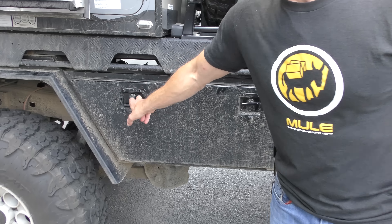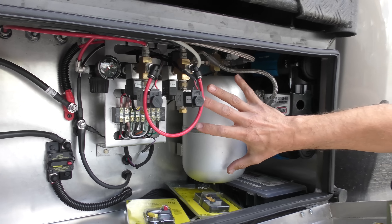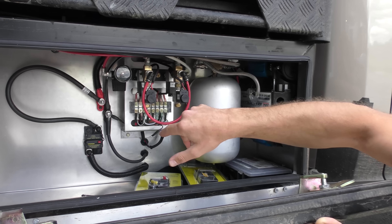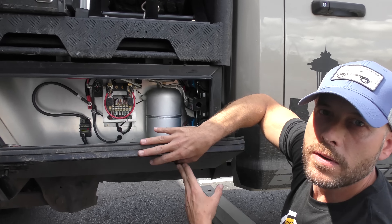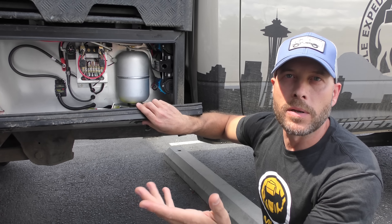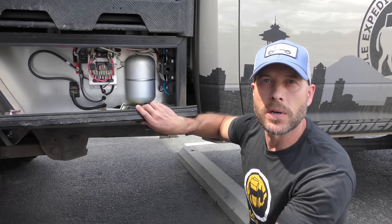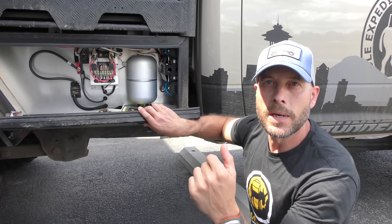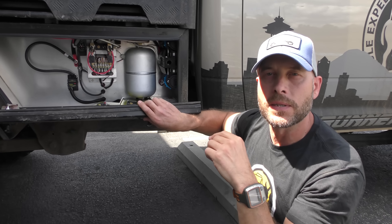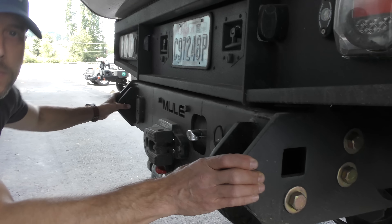We don't just use the tunnel box for throwing gear. We installed all of our air-up and air-down system for the airbags in there, along with a twin compressor and an ARB air storage tank. This system allows you to basically air up one side or the other of the truck for leveling capability at camp — it's also supplemental suspension. We can run the truck without any air in the airbags because they're equipped with internal bump stops. But if you're heavily loaded, the airbags can supplement the suspension to reduce bounce and dip from the rear of the camper.